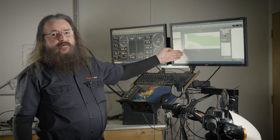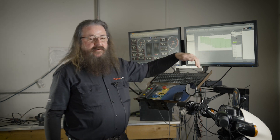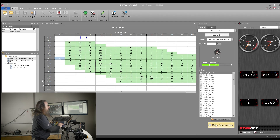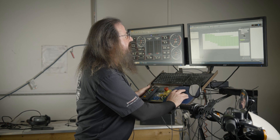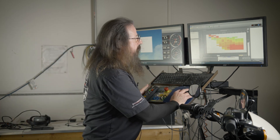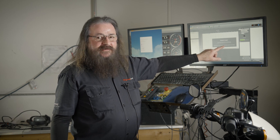We've got pretty good cell coverage on this. I used all the different configurations we have: warm up, steady state, free tune, load path. For hard-to-hit areas you might want to use free tune or load path, but primarily you're probably going to use steady state or roll-on — as you can see, that covered most of the cells in this map. Now that we're done with data collection, we're going to calculate a correction. TuningLink software is automatically going to do this for you and will show you every correction that was made in all the cells we hit. We're going to calculate the rear cylinder — all the changes that were made to the VE table in the rear cylinder. You can see we've got really good coverage. Now we have our finished tune from that session. If we want to continue tuning, we can leave it in TuningLink setup mode and apply changes and continue gathering data, making more runs.